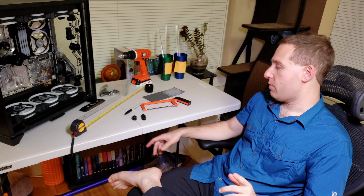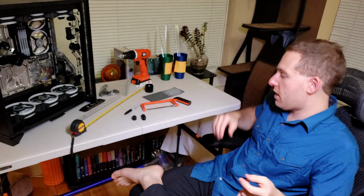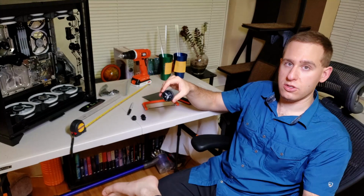So if you look online for some kind of do-it-yourself kits on the hard tube bending and cutting and whatnot, you're going to find a couple things. There are kits that they sell. I haven't actually done the bending yet. That bending stuff is over there, but the kit comes with a saw. I also bought myself a chamfer tool like this, which for one side does the inside of the tube and the other side does the outside of the tube. And basically you want to try and get a nice smooth kind of angled end on that tube, so when you're stuffing it into the O-ring on the compression fitting, it doesn't break it.